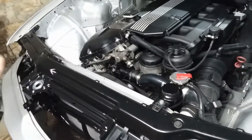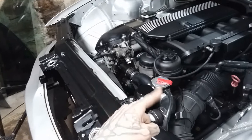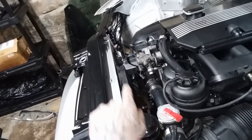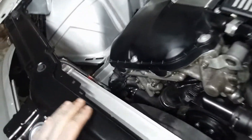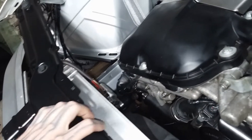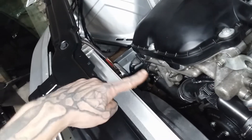The cooling system I've had for years — we discussed it before. It's an E46 M3 aluminum radiator with custom hoses, an inline filler neck with a recovery tank, a 3,000 CFM slim fan using the OEM fan controller and OEM wiring so it comes on when it's supposed to. The coolant temp sensor for the fan is mounted in the radiator hose with a coupler — it's a coolant sensor from the cylinder head. It's the same resistance as the original plastic one, so we simply put it in there, plug it in, and it works just fine.